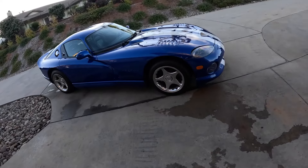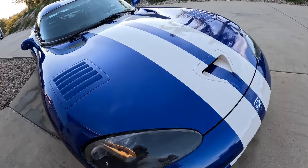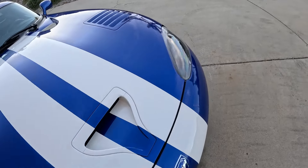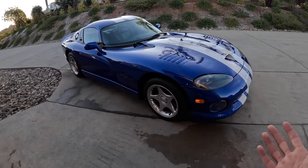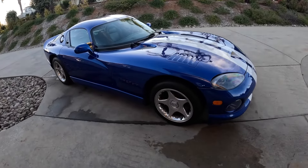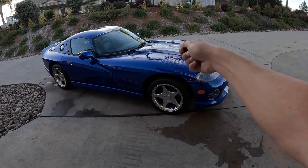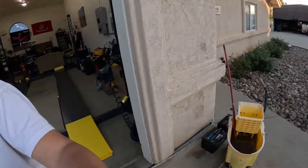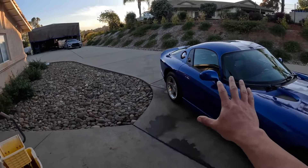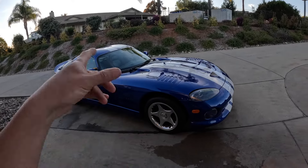It's been sitting for a little while and look — this thing is almost dry without a towel, I just did some air on it. You can see there are still a couple of wet spots, but this thing will not spot up. You can take a light towel right now, spray it, go lightly, and you won't cause swirls. But those little car dusters a lot of people use on dusty cars? Those literally scratch the heck out of your car — I would highly recommend not using those on any of your vehicles, especially a black vehicle.